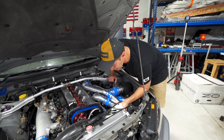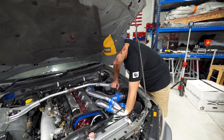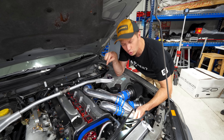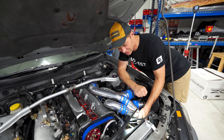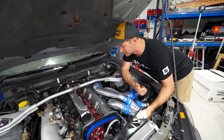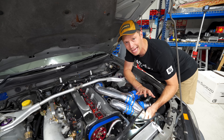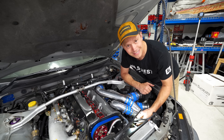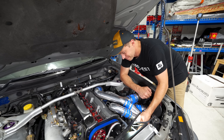Another small item I need to take care of: the belts are a little bit loose and they've been squealing, so I'm going to tighten them up. But I'd like to point out — you see this massive complicated twin turbo mess with coolant lines and oil lines — there's no leakage from it, which is a pretty proud moment. I was so paranoid; I thought for 100% sure there was going to be a leak. But we did our due diligence, we did our pressure test before installing this engine, and it worked out. Which raises the question: why did you not just go single turbo and make our lives easier?